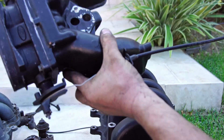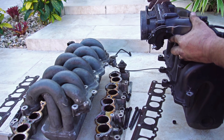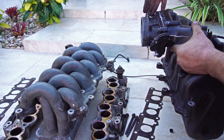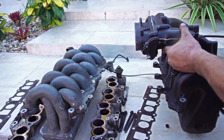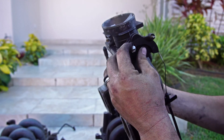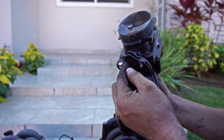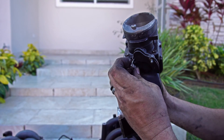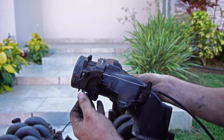The only other thing that you'll need is a longer throttle cable. The Mustang cable connects to the back side of the Mustang intake, so you actually need to get — I believe this one came from a V6. As you see it's not the one that's intended to be here; it uses one much like the Mustang. It's just that little pin that inserts in there, so I may have to rig something up with this. There's a considerable amount of slack on this.